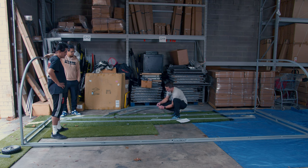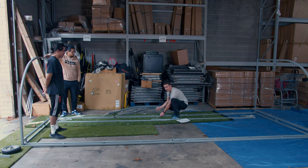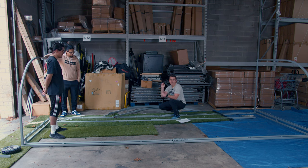Then you'll take your bolt, washer, and nuts. You'll stick one washer on the bolt and slide it through the backside with the round piece on the outside of the frame. So you'll slide that through the holes. Then you'll take your second washer, slide it on the bolt, take your aircraft nut, and finger tighten it down. On the aircraft nut, the side with the nylon ring on the inside of the nut, it's white, sometimes it can be blue, will be on the outside of the nut.